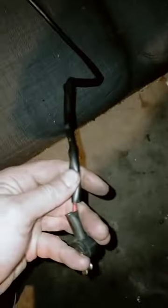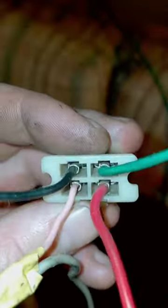I hope that makes sense more than my last video and clears up anything I said wrong that could potentially give you problems. Remember, you must use one of these or you will melt stuff — because as you can see, you've got big wires going straight onto your starter motor, and little wires that run everything else to turn it on and off. The key works by connecting two wires together: in one position, black and pink — which is earth and your kill switch — and in the other position red and green. Green positive is very confusing because green is earth on everything else.